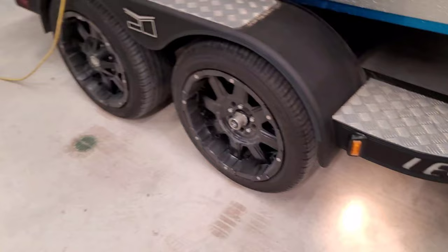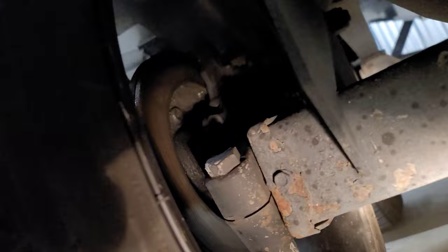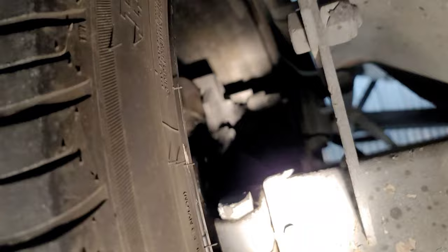Alright, back in the garage after coming back from Texas Boat World with the parts. I already took the cap off — I don't have any leakage on the outside of the hub, however if you look underneath here you can see we got some leakage, some slingage on the inside of the wheel. That one's pretty bad, and we've got to do the back rear one as well.